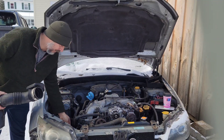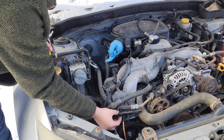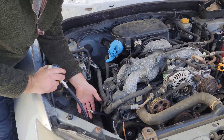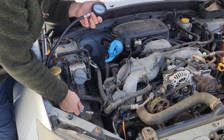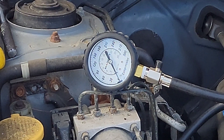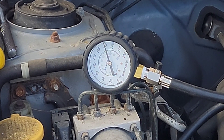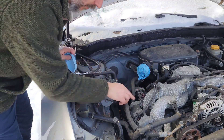Accessing the spark plugs in number one and number three. Removed the spark plug boot wire from cylinder number one and threaded in - I believe it's M14 - the compression tester fitting. It was actually the threaded hose, no adapter needed. Attaching the gauge to the valve - that was pretty healthy: 210 PSI.